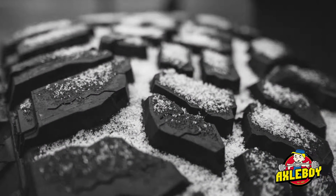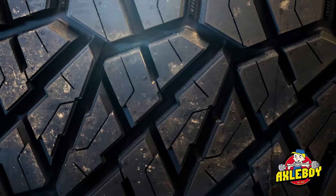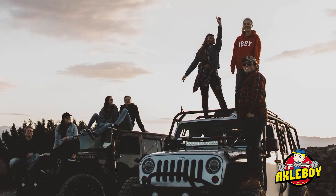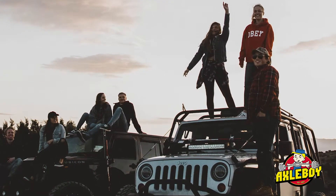The next step up is what we consider a hybrid tire — a really nice cross between an all-terrain and a mud terrain tire. If you look at the tread, the center line is more like an all-terrain, but on the outer edge you'll have larger mud lugs that can get in there and get a bite. They'll clean out if you get them spinning, and these tires remain quiet as well.